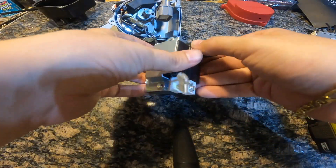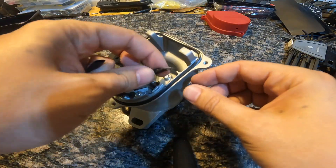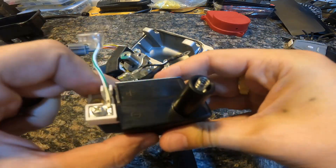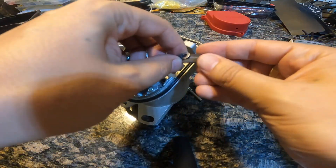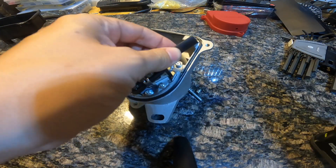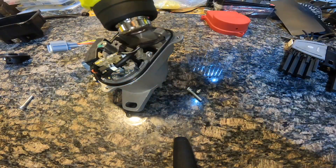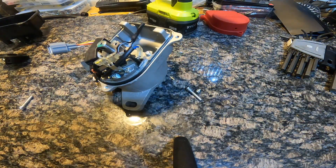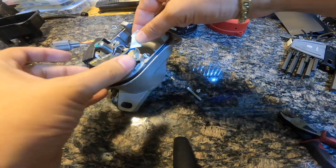Saving ourselves major ounces here. Now this looks like a ground cable, but it actually is the positive for the coil here. So we're definitely not going to leave that hanging around — not that we would even if it was ground, but even more so. So I'm throwing some heat shrink on here using a Ryobi heat gun. That's probably fine, but I always get paranoid on all things electrical, so just to be sure I'm going to throw tape over the end of it anyways.